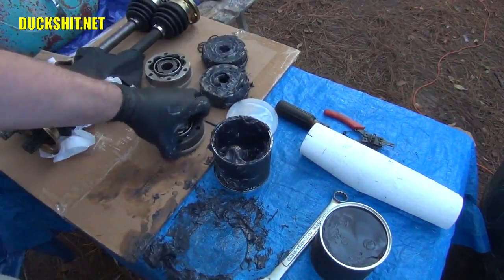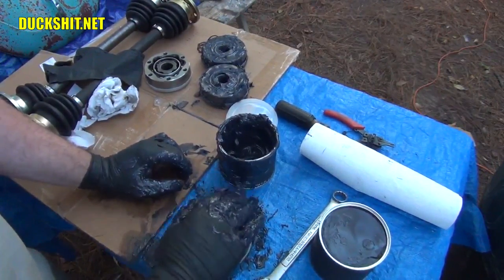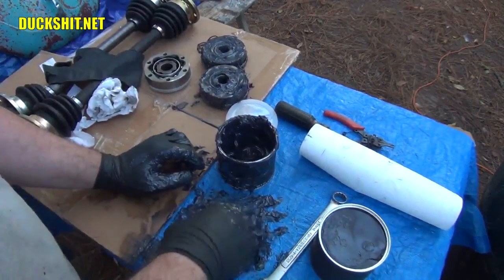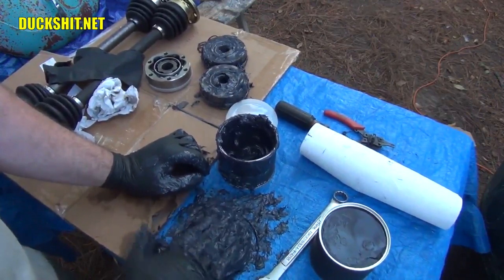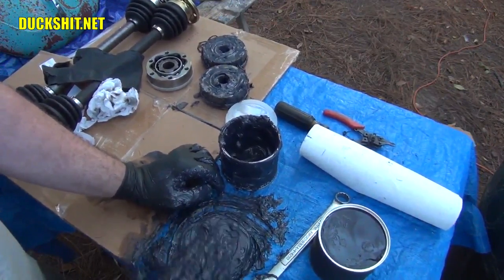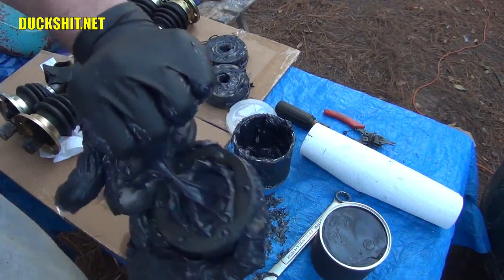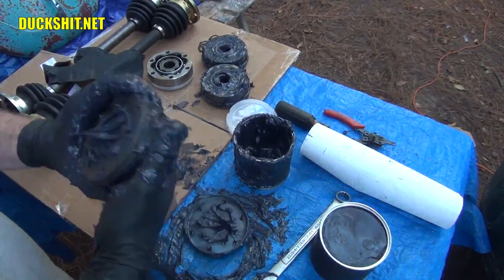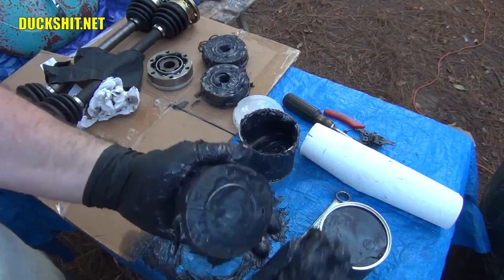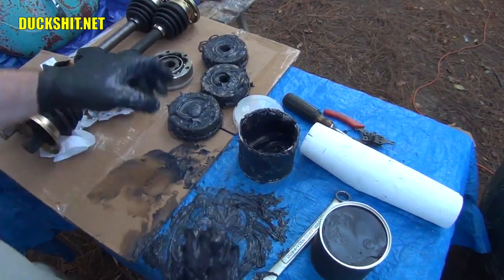And next one. The second one took grease real quickly. And we're almost out of a container of grease. It actually took less than half a container. I'm kind of surprised. It's the first time I'm ever actually packing them on a Volkswagen. Some of the grease just blobbed off the table onto the ground. If you do that, make sure you don't step in it. Go ahead and check the backside. Here it is. Already came through, it's already flush. Take a little bit extra. Just like that. Flush. Put it in the cup. Put it aside. Next.